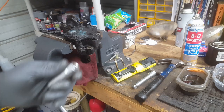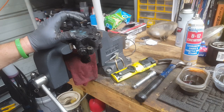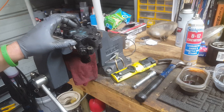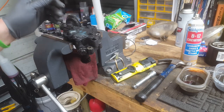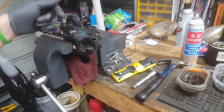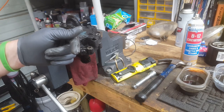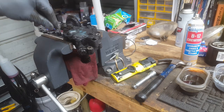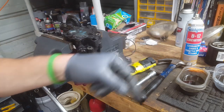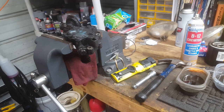It's probably not, but the bypass valve, if you're wondering how that affects your oil pressure, it's going to be a piston with a spring on one side of it, and when the oil pressure gets excessive, according to the manufacturer specifications, the spring lets the piston move, and it moves far enough it bypasses some of the oil pressure so you don't blow the filter off of it. But if it's stuck partially open, then it could be reducing the oil pressure somewhat.